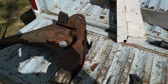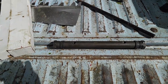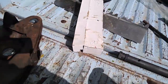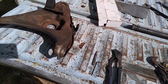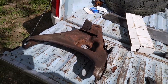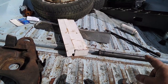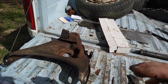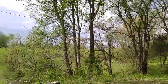Okay, in between the rainstorms I'm gonna try to get a little bit of work done today. We're gonna try to put the other new lower control arm in. This end was a fight yesterday because the end cap on these things would not come out — it took me half a day, I had to literally cut it into little pieces to get it out. The threads actually look more like just grooves than threads, even on the good ones. So I'm going to take these end caps off and start them in here to make sure they're gonna work before I try to assemble the whole thing.